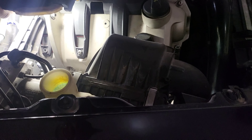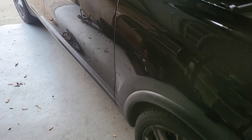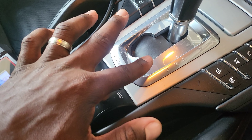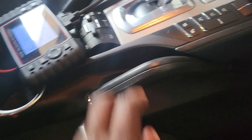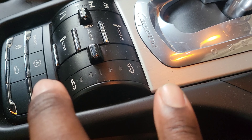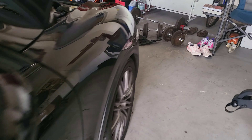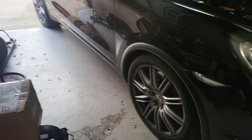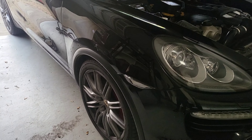Let me get the vehicle up. I have it in service mode — if you don't know, you do that by holding the height adjustment lever right here, push it up, hold it for 10 seconds, both of these arrows will turn red and they'll be blinking. That's when you know it's in the service position, so it disconnects all four air shocks from the rest of the system so that the compressor does not turn on and try to fill the shocks up as you're jacking or lifting the vehicle.